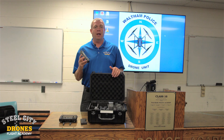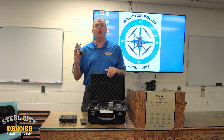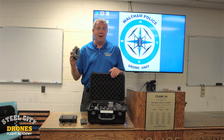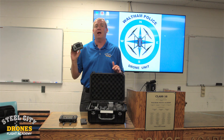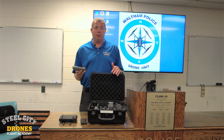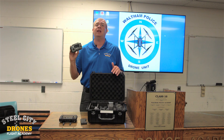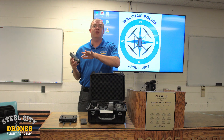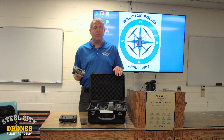Where you get up in the air, everything's normal for a little bit, and then you might fly out to an environment where you get some high EMI, some wireless, or just excessive metal. It's almost impossible sometimes to tell that. So sometimes the aircraft can simply throw you out of position hold and put you in Atti mode, or the aircraft just doesn't respond and in some situations can just go out of control and start flying away from you, and you're not really sure what's happening.